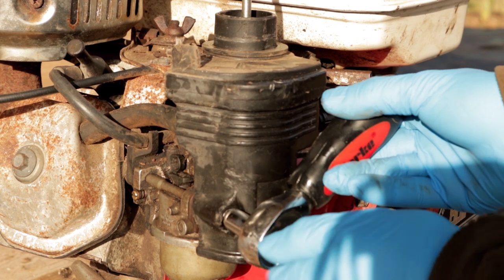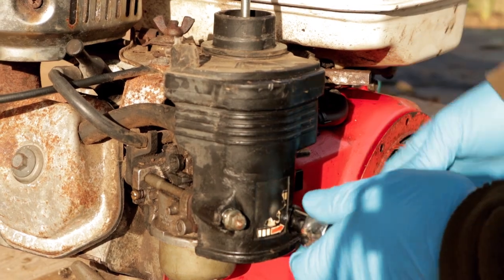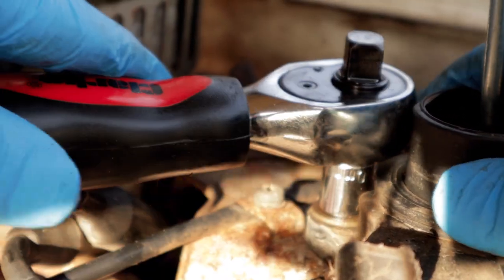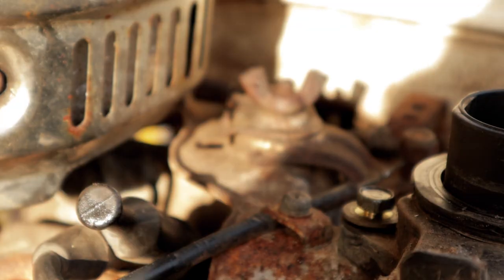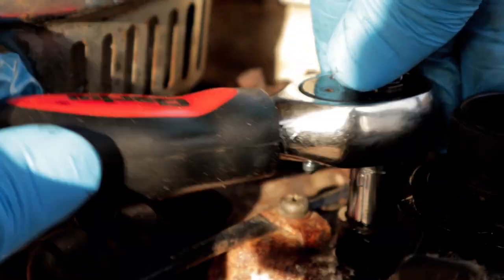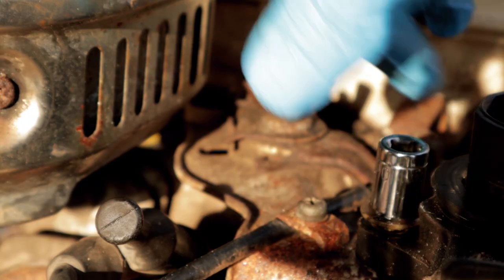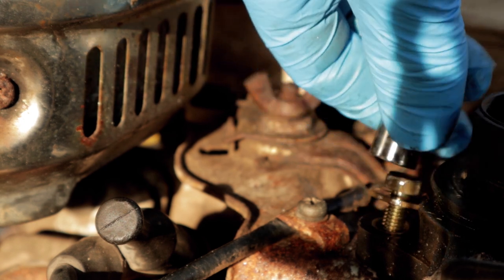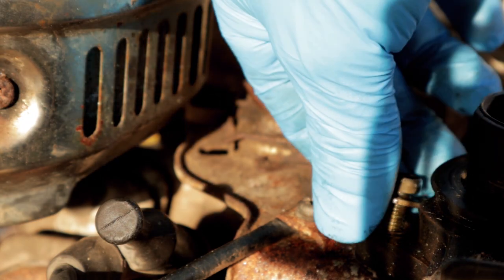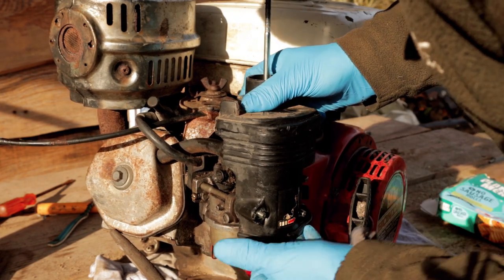And these have all been 10 millimetres so far. Spray a little bit of penetrating oil on there as we go, because it's quite corroded actually. And sometimes you can wind it back down a bit to lubricate the threads and then kind of work it out forward and back like that. So we should be able to wiggle some of this off now, hopefully.